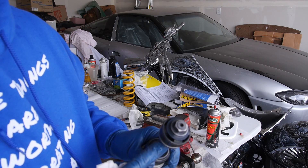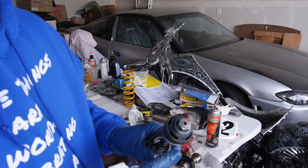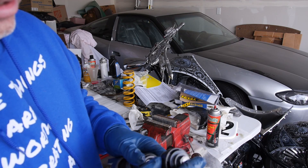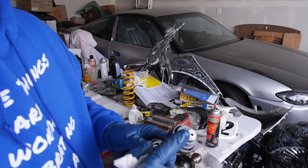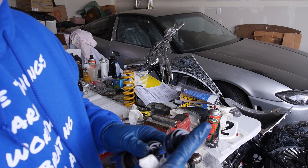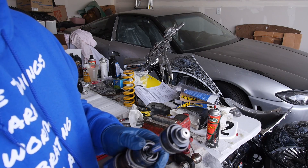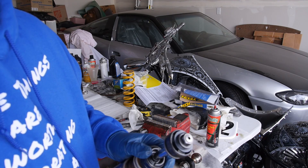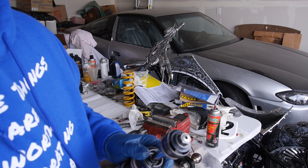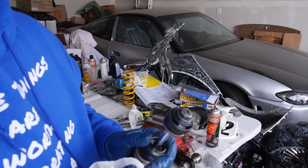To stake means they use a tool to pound and flatten the metal over this nut so that it doesn't back off. So in order to get it off, what you have to do is file off that staking. I usually use my grinder and I simply grind the edge of the nut and the staking on about a 30-degree angle around the whole thing to eventually remove that nut. Make sure you get all the staking off.